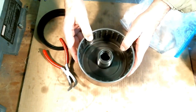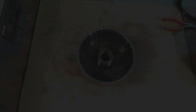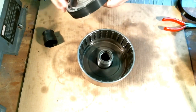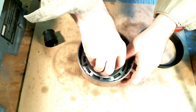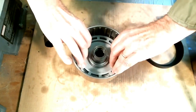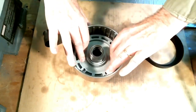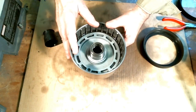We'll bring the FMX direct clutch piston now. Let's try this one — pop the inner out, the outer, and drop it right in. Perfect, dropped right in. Again, you don't have a whole lot of time. It looks like I've got a little bit of time left, but I would say in about one minute you will not be able to drop that piston back in if you took it out.